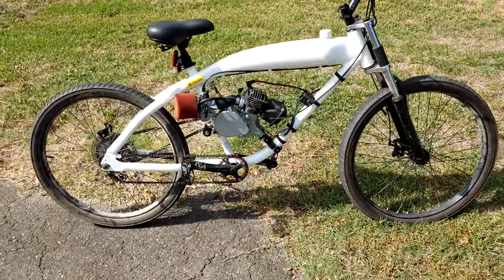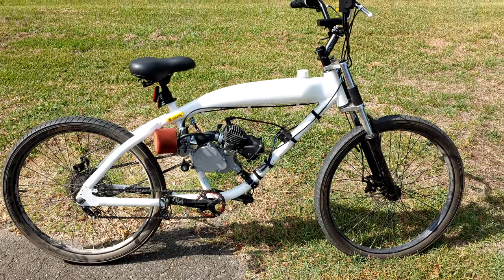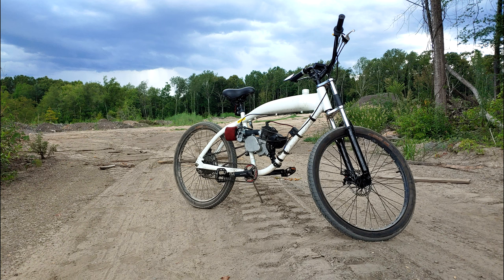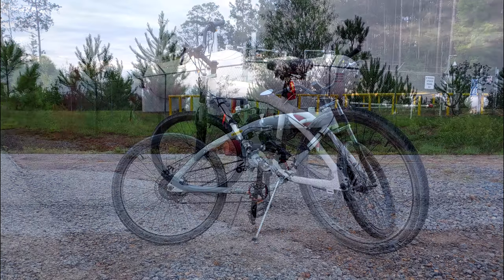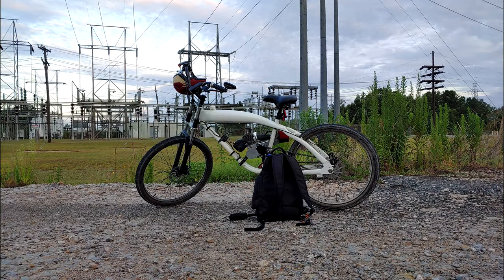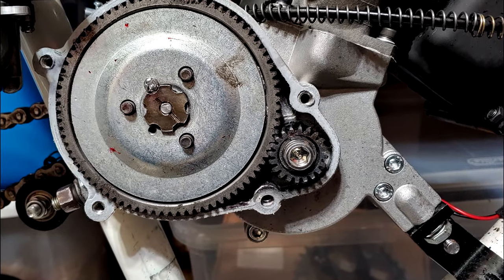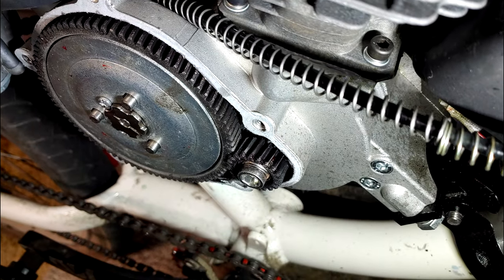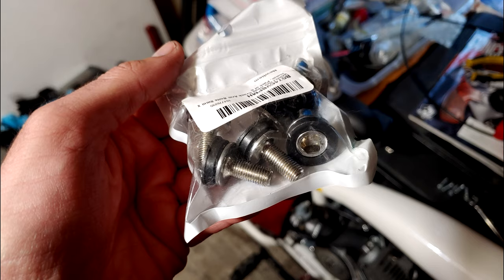Well, mine's a cheap knockoff that I think I got for about 30 bucks off Amazon, but it seems to be doing the trick. Alternative carburetor option would be a Stihl 090 Tillotson. It's a 52mm bore with a 38.6mm stroke. The entire bottom end is disassembled, cleaned, and reassembled after inspection. And he helps improve the quality of life by replacing the useless bolt for the small bevel gear with something that you can actually remove without a torch and impact hammer.